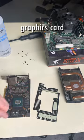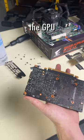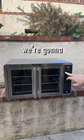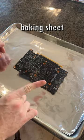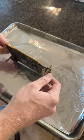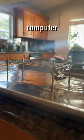But seeing how dead this graphics card is, it's all we got left. After tearing down the GPU completely, as well as giving it a good clean, we're gonna preheat our oven to 385 degrees. Then we want to place the GPU face down on a baking sheet, but we want it to lie flat, so we need to elevate it with something. You can use tinfoil balls, but in this case I'm using tall computer standoffs.